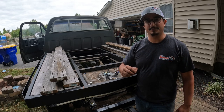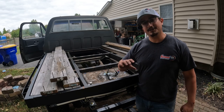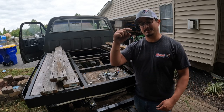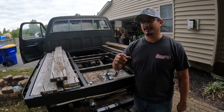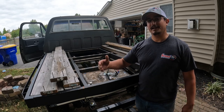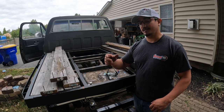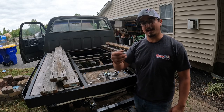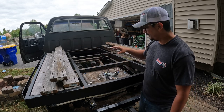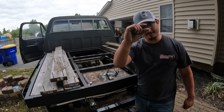A quick note about external fuel pumps: in this case, if you're using a stock tank, I think you need to use a stock hanger and pump setup. I tried using an external pump for years with this stock tank and I never could get it quite right. What an external pump needs is for the inlet to be sitting at or below the bottom of your tank. To do that on a square body, there's nowhere to put it — beneath the tank is just air. External pumps have a better application in a car where you have a fuel cell in the trunk, so you can run a line going down to a fuel pump gravity-fed. You don't want those external pumps sucking — they're not good at sucking fuel and then pushing it. You want the pump at the lowest level the gas is, so it's only sucking a short distance.